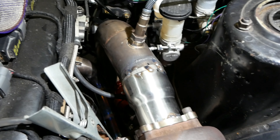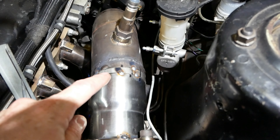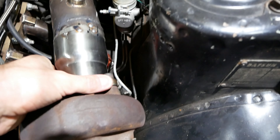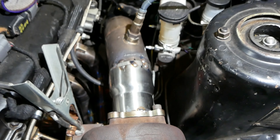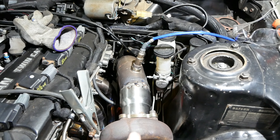Here's a picture of the new — or redone — downpipe. There's just that little pie cut in there. This is the original, and here's the adapter piece. This is going to make this whole thing so much easier to get on and off — the longer transition gives us access for the bolts. So I'm going to pull this out, weld it all back up, and then reinstall it. Then maybe we'll get to finishing the rest of the exhaust.